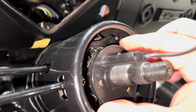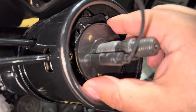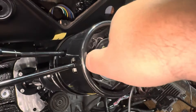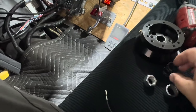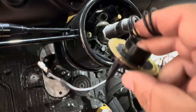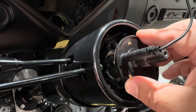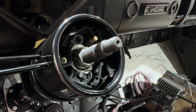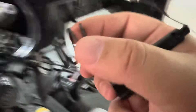When you put your blinker on and you turn, it cancels out that blinker so it goes off by itself — you guys are all familiar with that. Now, they give you a spring which some instructions say goes inside here or down on the shaft first, and then the cancel cam goes over it. It sticks up prouder and has spring action, but that's not correct in my opinion — it's called a bearing preload spring. What I found is that I don't need it at all; it actually hurts my installation and doesn't allow for proper installation. So we're going to discard that. They give you this little tiny bearing or spacer, which I put down there just so the cancel cam doesn't dig into any mechanisms. We install the cancel cam with the horn button at the 10-and-11 o'clock position.